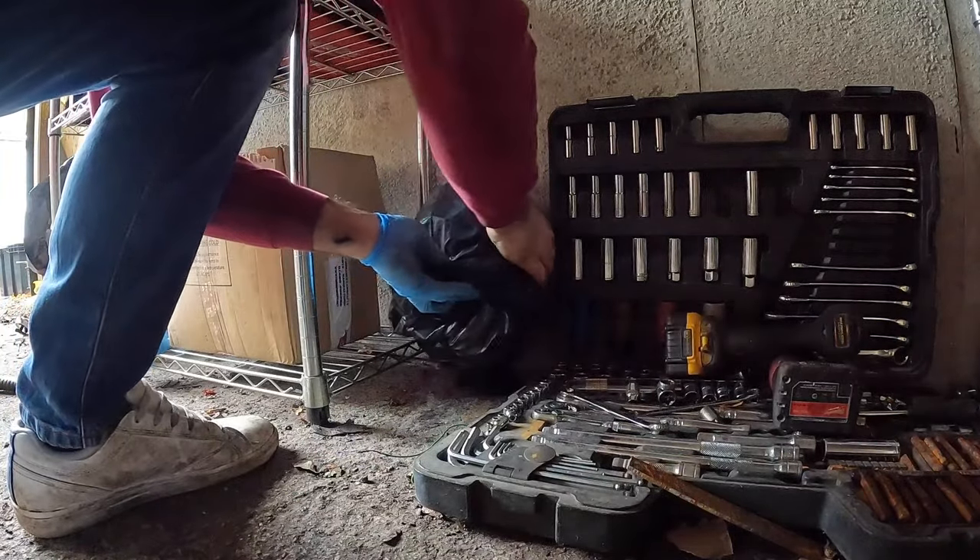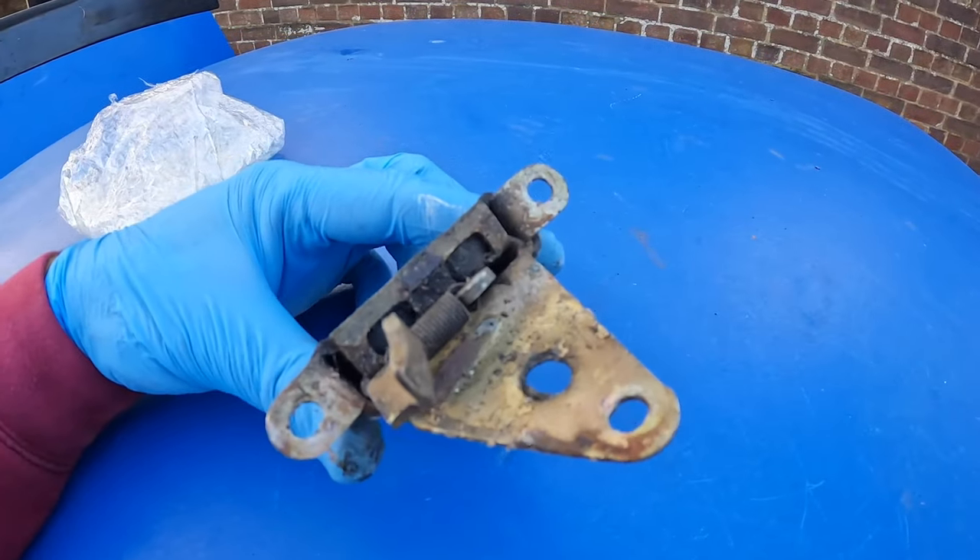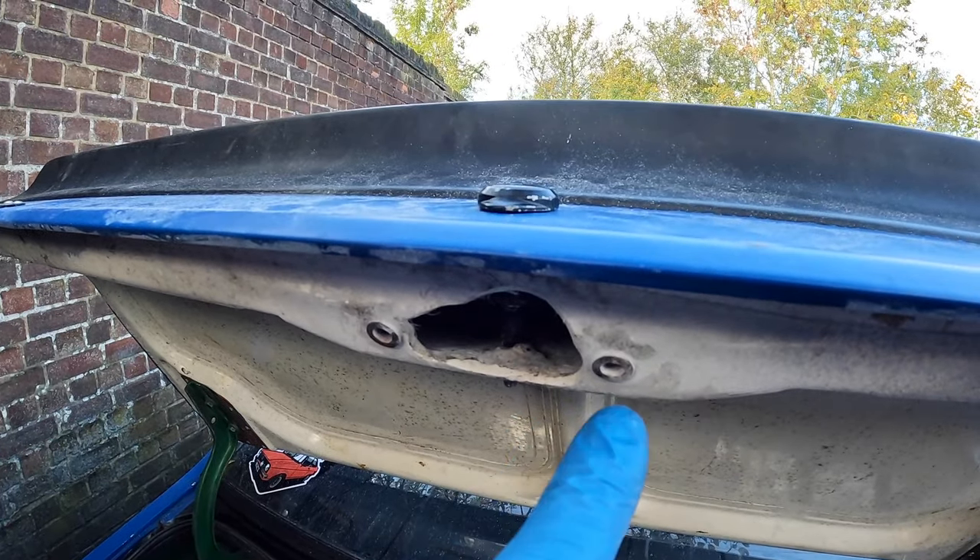I've always wanted to have a go at setting up a diff and it's not easy. I think maybe I should get Inky to talk me through it properly — it would definitely be easier with a vice to hold the diff. At this point I'm just going to leave it as it is and send it. There's tension on the bearings, there is some backlash, and the crown wheel and pinion appear to be meshing okay-ish. I'll wrap this up and tuck it in the corner as I won't be fitting it today, but there are a couple of other jobs to crack on with.